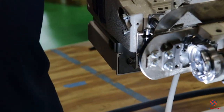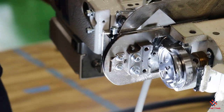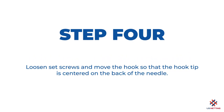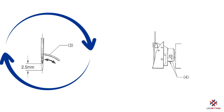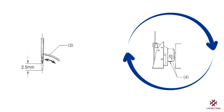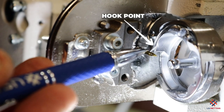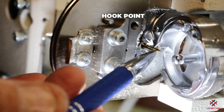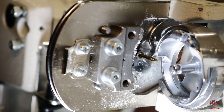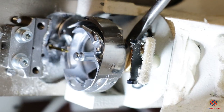Once you take the bracket out, be aware that the part that normally is not turning is now moving. Where it shows the condition of the hook centered on the needle, you also have to have what's called needle clearance — this is as close as you can get it without hitting. Right now the hook point is centered on the back of the needle, and you can see how much travel there is. You want less than a thickness of paper between those two parts.